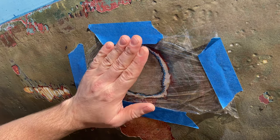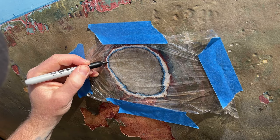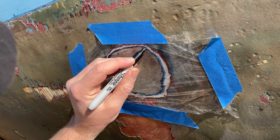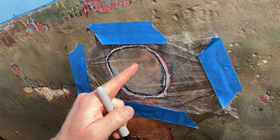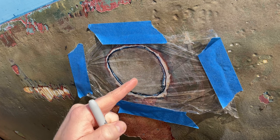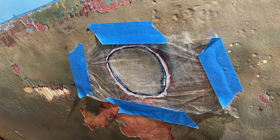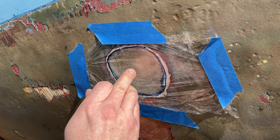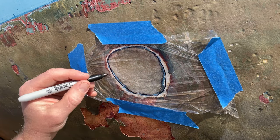So here's my process. We've dished it out. It's 12 to 1. And then, of course, we're gonna go largest to smallest. We're gonna need two large ones. So we'll go large all the way down to small, and then one final large one, and then peel ply.